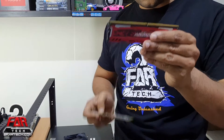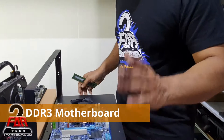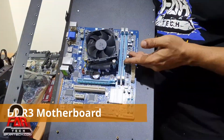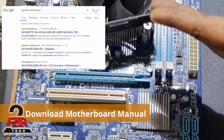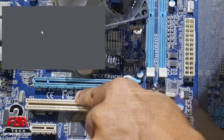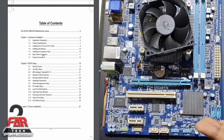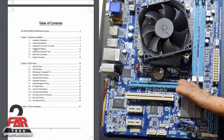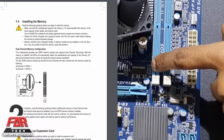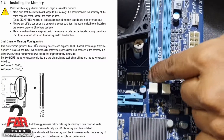That curve is how you easily recognize DDR4 memory. Before installing the memory, you need to know which slot on the motherboard should be used first. Make sure the motherboard supports DDR3 or DDR4. Go to the website, Google the motherboard name, put the name with a space, search 'manual', download the manual, and find out what memory models are supported.